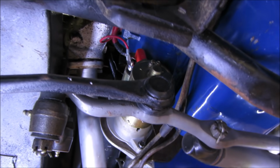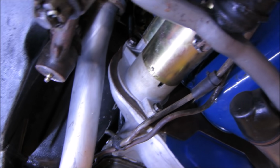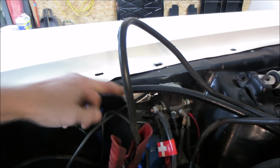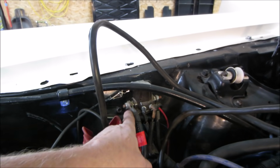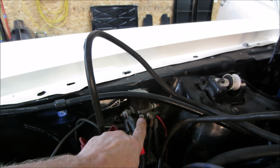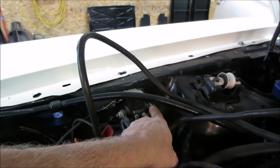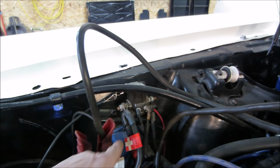This is definitely just throwing another wrench into the works though. Don't want to lose you on this, but I gotta try to explain it. So all right, this is the battery side coming in. See the little plus side going in. Normally you get a ground, and this is 12 volts coming from the ignition switch. You turn this, it fires a coil inside, makes that input go to that output. That output goes down to the starter.